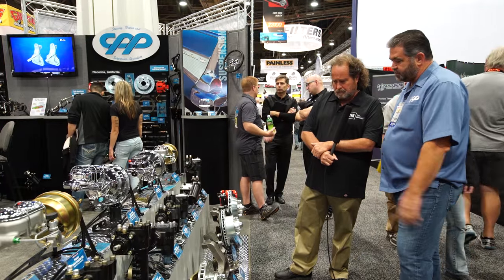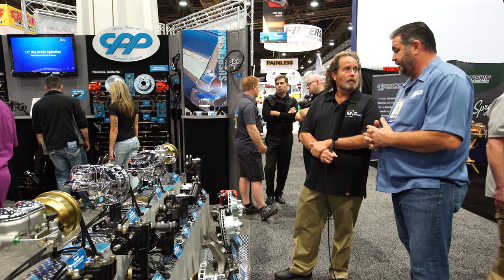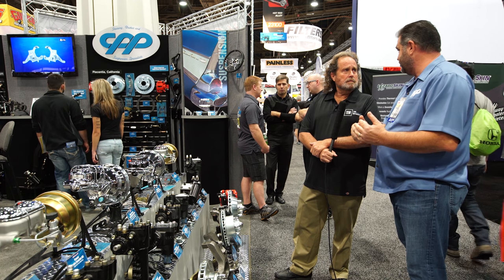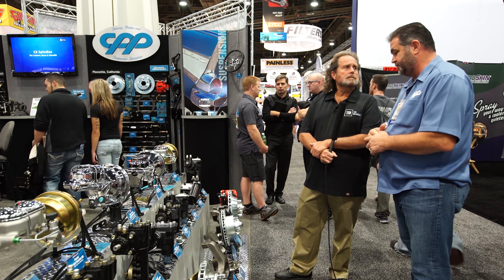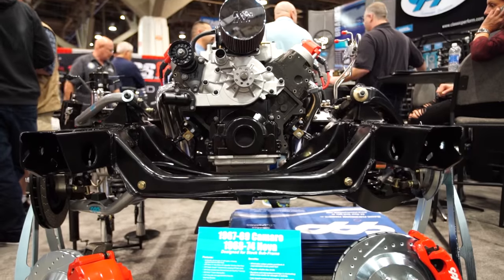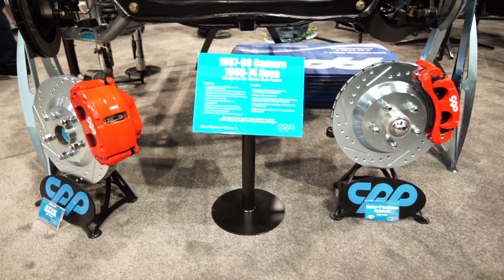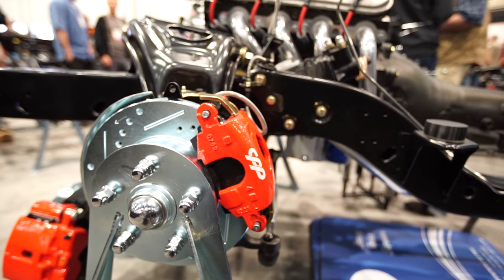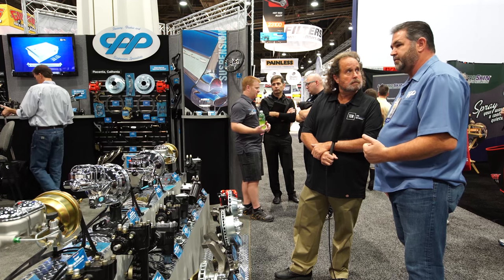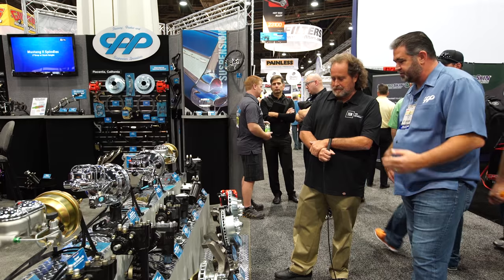One of the advantages too is that a lot of people have a long-term relationship with their car, and so the way they have their car today isn't necessarily how the car will be five years from now. This spindle platform allows you to start with an entry-level system, and over on this other display we've integrated some of the other brake packages that are out there — it can always be upgraded to those systems. When you make that transition to a different brake package you don't even have to realign the car. You don't pull the spindle off the car. All the steering linkage and everything stays the same.